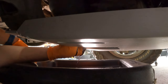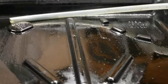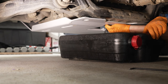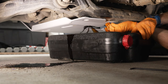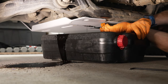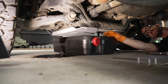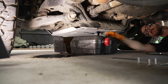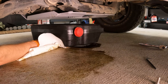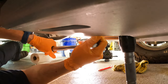I discovered an issue with my drain pan — it has ridges supposed to help the oil flow toward the hole, but in my case the oil hit it directly and shot out all over my floor. Super cool! After the oil has started draining for a while, remove the oil cap in the engine bay. If you remove it beforehand, there's a high risk of the oil shooting out too quickly and escaping your drain pan. Once all the oil is drained, install the plug with a new gasket and torque to 30 foot-pounds.